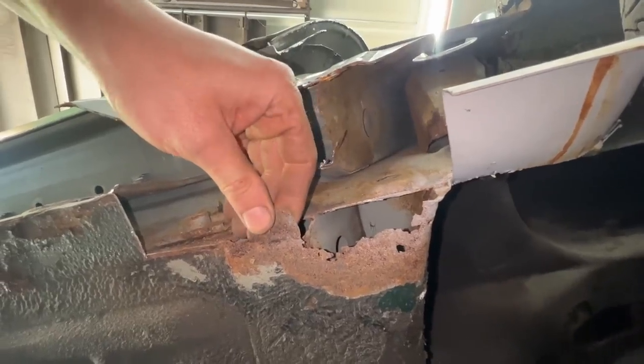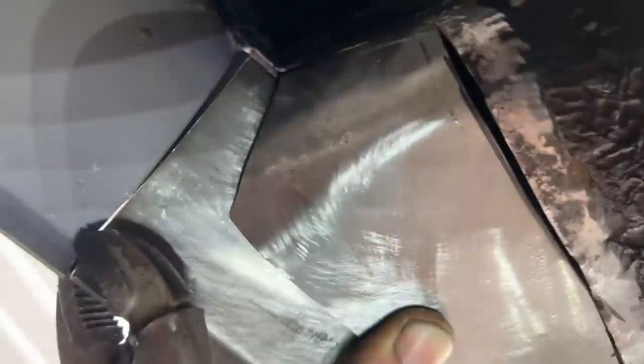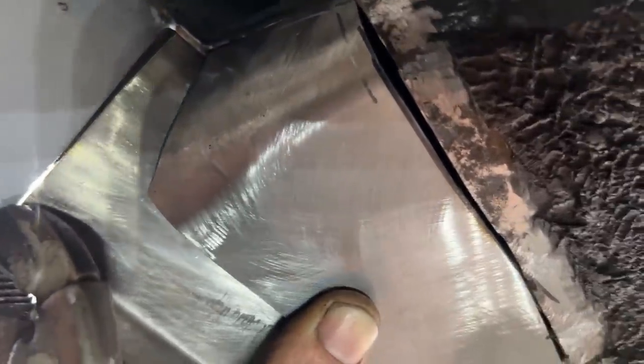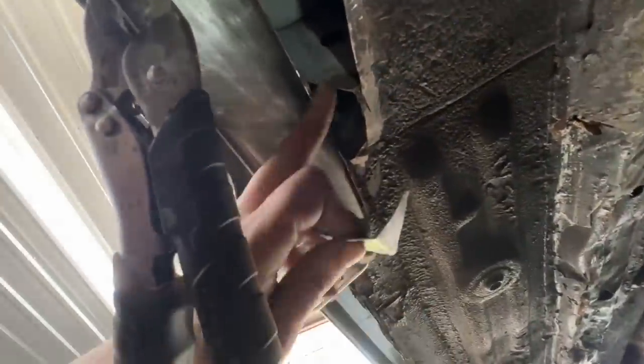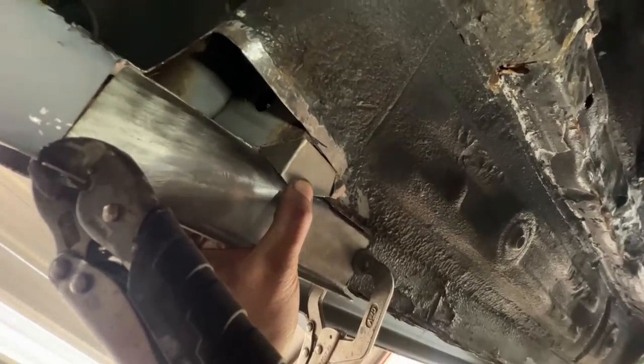You don't know what I mean? I'll show you. See here - there's no flange. I can weld a flange but is there a point to it? I don't think so. I'm just gonna weld the patch to the inner seal, or whatever that is, and that's it. Underneath though there's another layer that I'm gonna repair like this, and the two are gonna overlap - that's how the two bottom parts overlap here, so I'm gonna do it the same way.